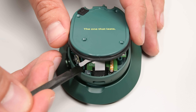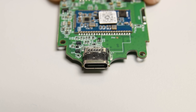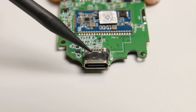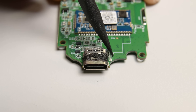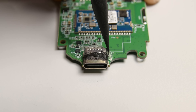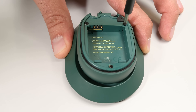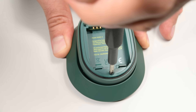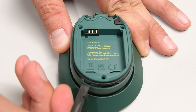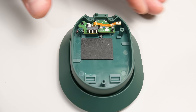The prioritization of modular repair over component-level repair is most evident around two of the three modular USB-C ports, both of which are covered with a gooey rubber adhesive to achieve the IP54 water resistance rating. A compression gasket would have made for a more user-replaceable alternative here. While it would be nice to have the option of changing individual components like the USB-C ports and the boards, ultimately that's a relatively small complaint against an otherwise thoughtfully made device designed with repairability and longevity front of mind.